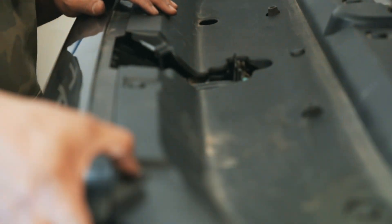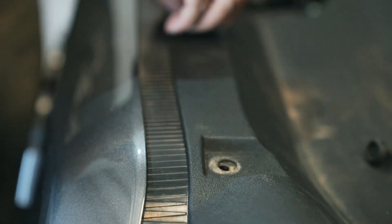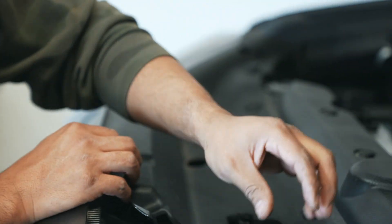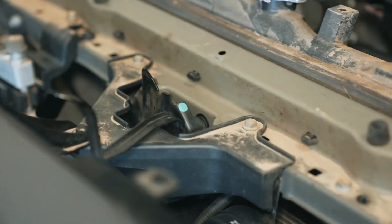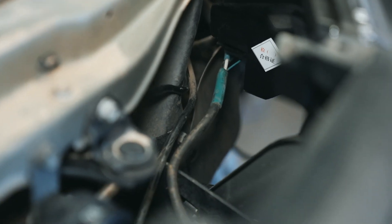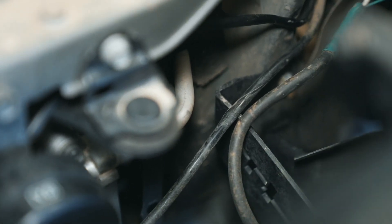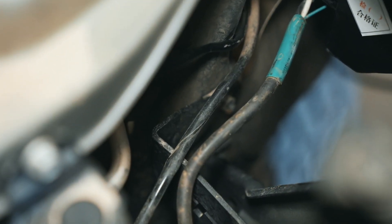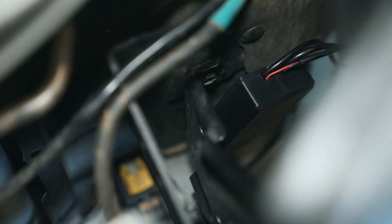We're going to be taking off this cowl on the very top part — just push in these clips and then pull it off. Do so to all of the clips and then remove this cowl. Once you have the cowl off, this is what it'll look like behind it. We have this off for easier access to the back side of the headlight and the bezel below, and also because we're going to be using a factory mounting location for the module. In the kit you will get this module, and we found a factory bolt over here right next to the driver's side headlight bracket.